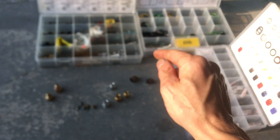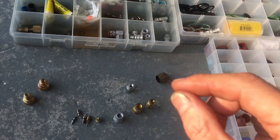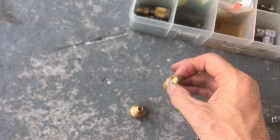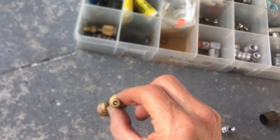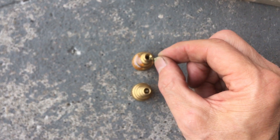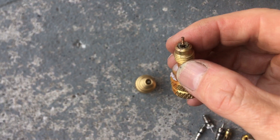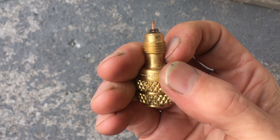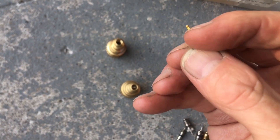This video gets back to that point: why do you not have to pull valve cores on the newer cars with R134 or R1234? Here's an example of your old R12 systems with quarter-inch fittings. Here's one installed and here's one you can take out. That is the full diameter when you remove them. When you don't remove them, there's a little tiny opening where refrigerant goes to the left and right, but it doesn't pass that rubber seal — it comes out the bottom of the valve.